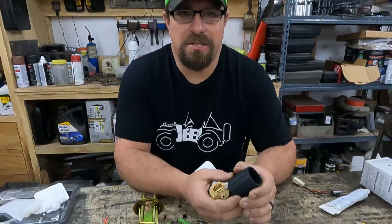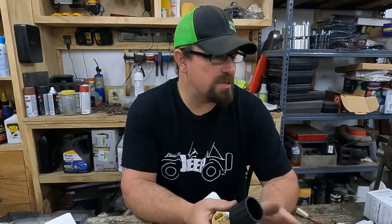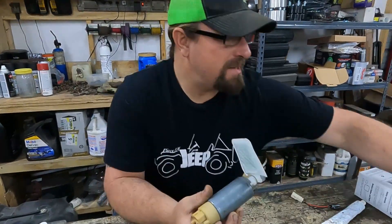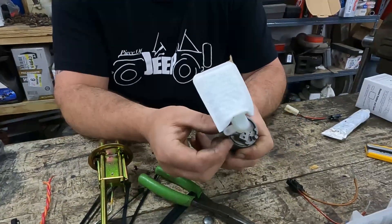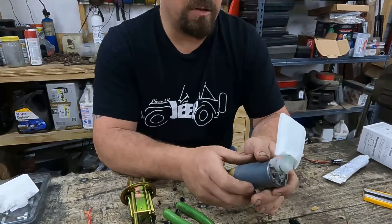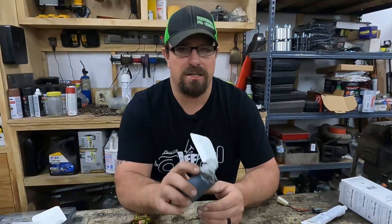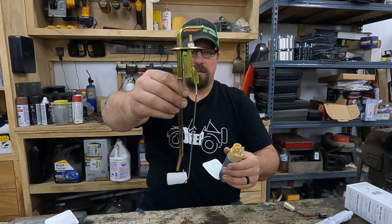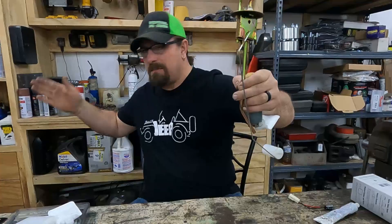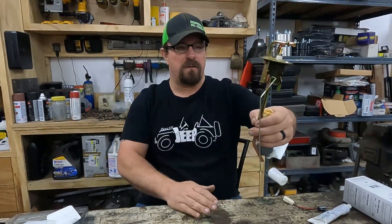Here's what I found: this installation kit is a universal fuel pump installation kit but it's specifically for the Quantum Fuel Systems fuel pump, not this stock fuel pump. But it came with enough parts that I was able to get a piece that fits super tight into the fuel pump — pressed in, it is not falling out. That adapted to this strainer, and I put a little touch of super glue on the outside, just on the very edge, nothing inside so there's no super glue on the interior. Now this strainer is permanently attached to this adapter and it's going to work perfectly. This goes in our fuel tank, and once we cut this off, our fuel pump will bias towards the back of the tank, getting it past the 45-degree curve where the tank comes flat and then angles up. That'll bias the fuel pump to the back side of that 45. It's going to be perfect.